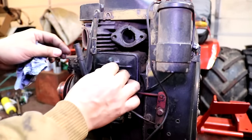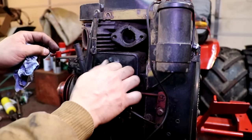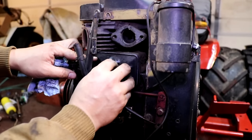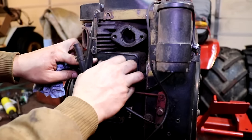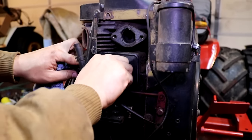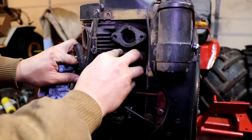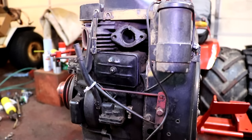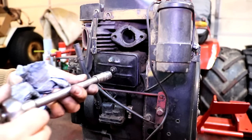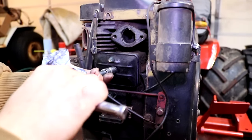Once you get all these covers back on, all you have to do is screw the nut back on. Be careful when you screw this nut on — all you want to do is gently snug it up. If you put in too much pressure, you'll actually start to collapse this outer valve cover. All you have to do is screw it on finger tight, take a wrench, and just add a tiny bit of snugness — that's all that's required.